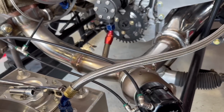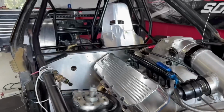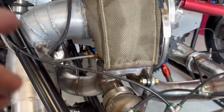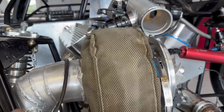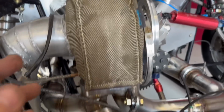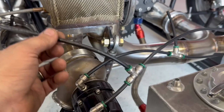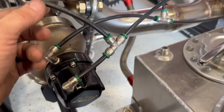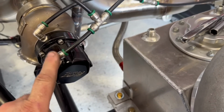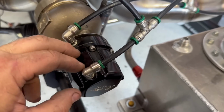But in our race car, we use CO2. It is a 5-pound bottle. It's in the car in there, and basically it's got 2 solenoids. So when Austin hooks up all the Holley stuff, there'll be boost control. I tell it not how much boost to make, but how much CO2 pressure, how much dome pressure to put on top of the wastegates. And that's what these lines are. So you see we got these tied together. These go to the top of that same valve with the O-rings.